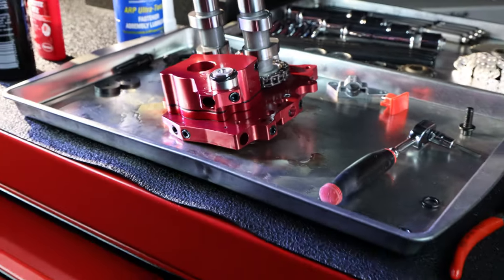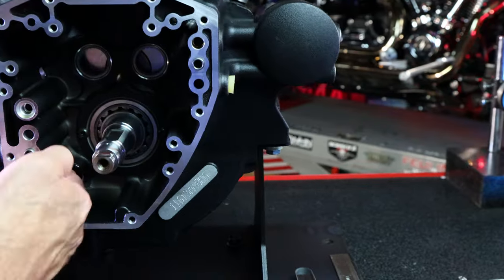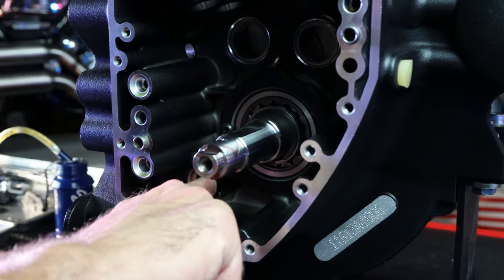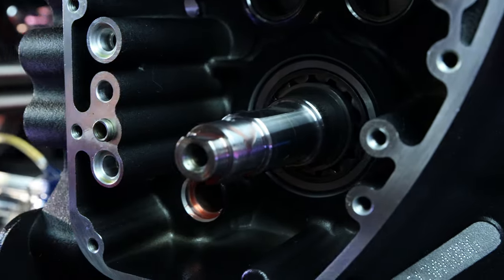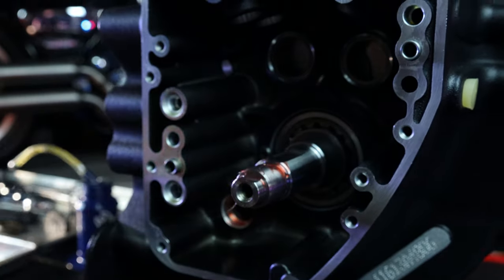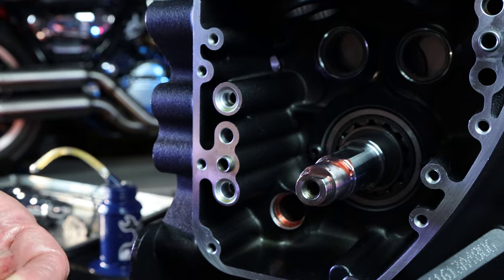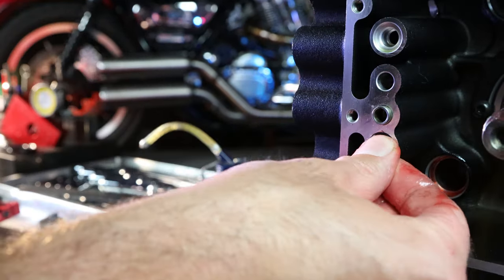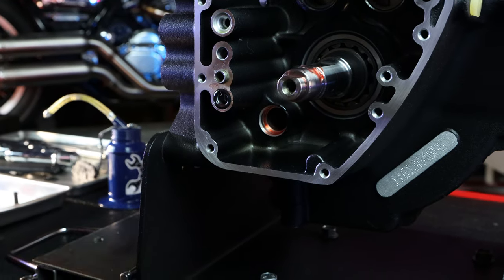Make sure that we get some oil put in the scavenge port hole of the engine case — we don't want any hiccups there. That's a very important seal. Also hitting up the pinion shaft: there are a couple of o-rings that we have to put in, and a little engine lube on them will help keep them in place.